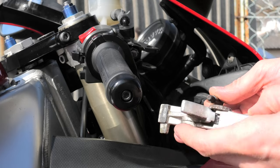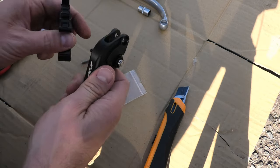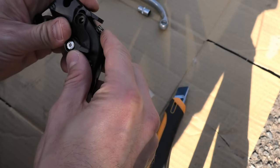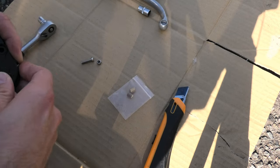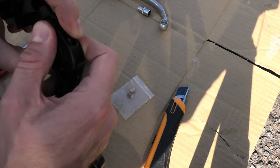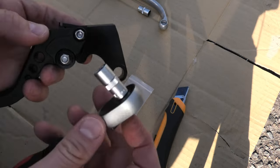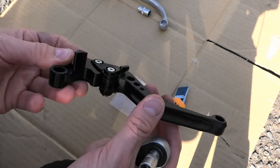It's just a little tube inside - nothing crazy about that. So you have these bits that go together like that. There's a little spring that comes in the bag; it sits in there with a nice little seat. You get it sitting in there nicely, match that head to that head, and you've got a nice nylon-threaded nut to go on there. We like nylon threads because you tighten them up and they don't come loose again. Good 8 mil to tighten that up and that's all it takes to assemble it.